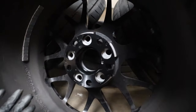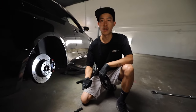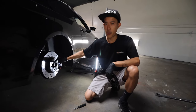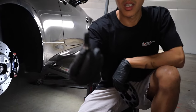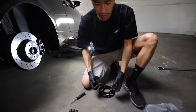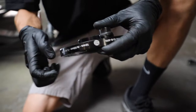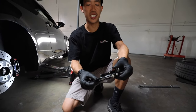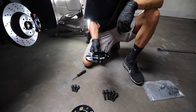You can purchase cheap spacers online that aren't hub centric — without this lip, or it doesn't fit properly, it's universal. Sure, it may work, but without this lip there's nothing to center that wheel. When you reinstall it, you're depending on the lug bolts to center the wheel, and it might be clocked a little different. Once you torque it down to 95 foot-pounds, it'll be very hard to shift. That's why you want it hub centric — it assures zero vibration.